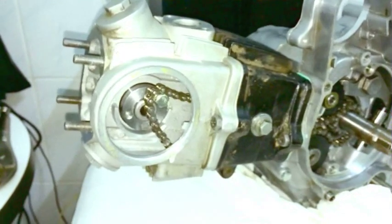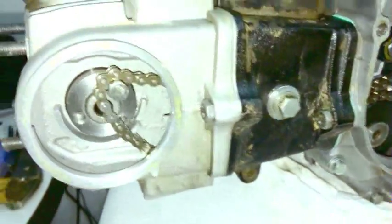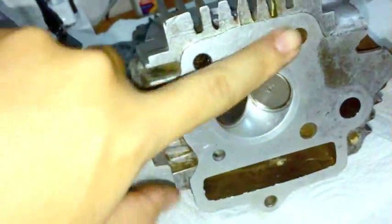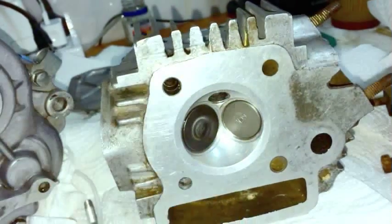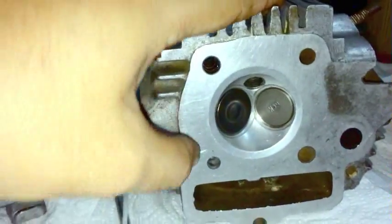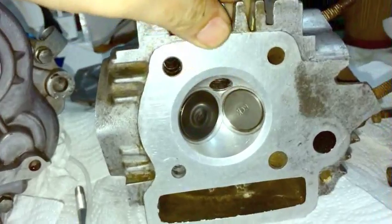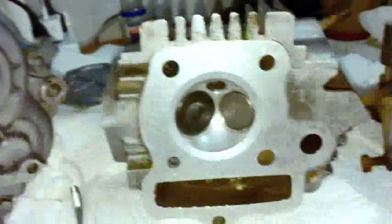And the problem, I mean, after I took apart the engine, I found on the cylinder head, so not this one, this is my Cub head, but I'm just showing you for example, there was almost like a straight jet of, like a big cloud of burn mark on this side of the engine, and I couldn't figure out what was going on. The metal had scored too, so it was really hot, so a lot of gas had escaped from here, and this side was completely fine, there was nothing wrong with that. But the head gasket had burned all the way through on this side, and I thought, what in the world is going on? Now, why did it do that?